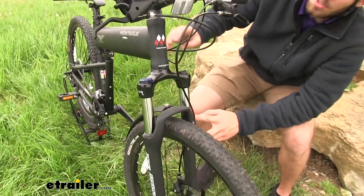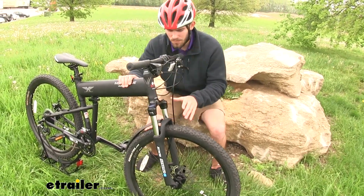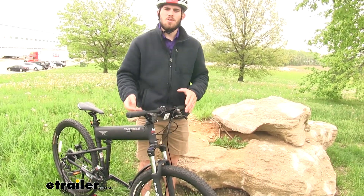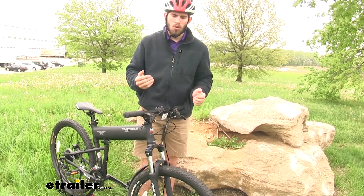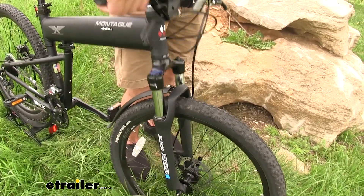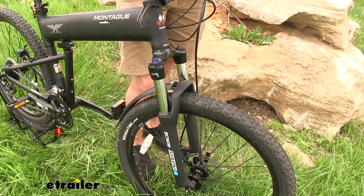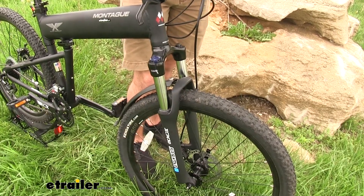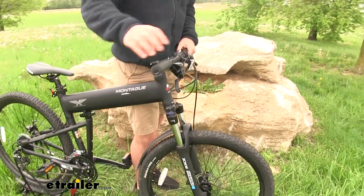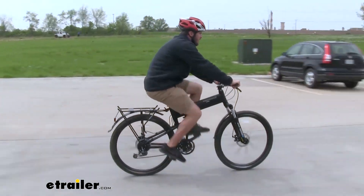We're going to have a Suntour lockout suspension system, which is great for absorbing a lot of impact when you're off-roading. The great thing about the lockout feature is that for occasional pavement rides, you can lock it out completely so the suspension doesn't take away the energy you're using to pedal hard. Right now it's unlocked — you can see pushing down it's absorbing a lot of impact. As you tighten it up, you can adjust it for the terrain you're on. If it's not smooth pavement but still a bit rocky, you can adjust how much impact it absorbs. And when you lock it out completely for pavement trips, you can see it's not taking any impact, so you're not wasting that energy.